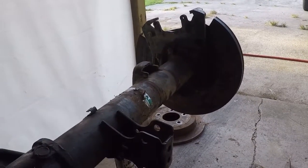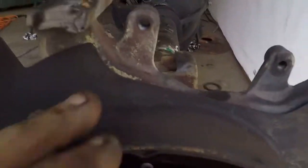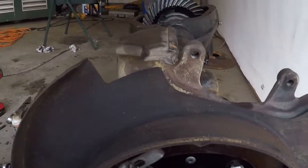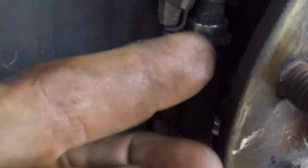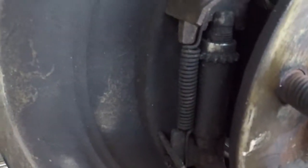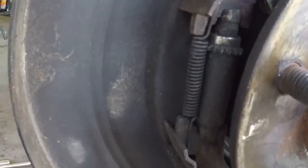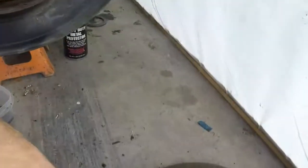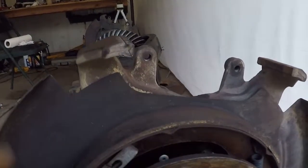I'm going to do a little cleaning first with some brake cleaner, get all the goo and crap off of the shoes — especially on this side where the oil seal was leaking. I'll get that cleaned up, scuff it a little bit, pull this apart down here, get that actuator taken care of — which I guess I should have done before I put the axle back in, but oh well. I'm going to do both sides, get these back on it, get the calipers back on it, and that's where we're going.